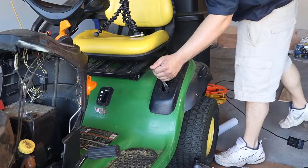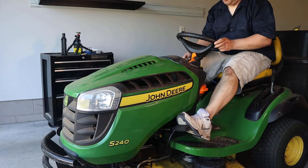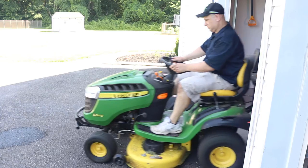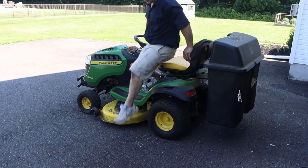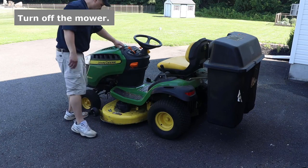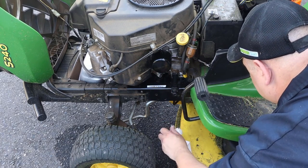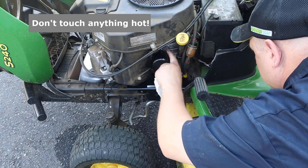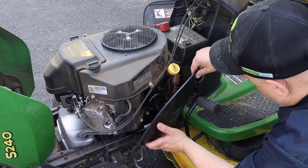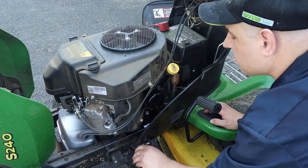I remove my board and bring my deck up. I didn't put the cover back on yet — and there's a reason for that. What I like to do is turn it on and idle it outside. Don't idle it in your garage unless you have a death wish. I idle it just outside my garage for a few minutes, then come back and check to make sure there's no leaks. I poke around with a towel on my finger and feel around the gasket and underneath. If I can't feel anything, then I'm good to go. Then I put the cover back on, slide it back in place, tighten that one bolt, and your oil change is complete.